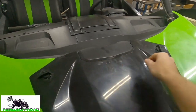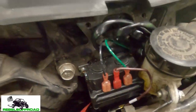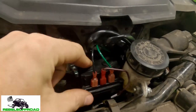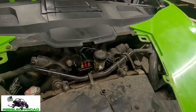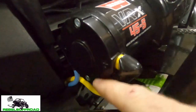We put the winch solenoid in a kind of unique place. We wanted to put it somewhere high and dry but also accessible in case we needed to change it. We ended up putting our solenoid right up here — just got some self-tapping screws, drilled some pilot holes, and secured it there. If we ever need to change it, it's just two screws. Also it's pretty high up, so when we go through water crossings it won't be underwater.